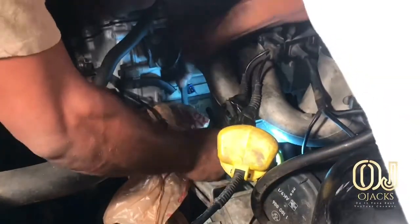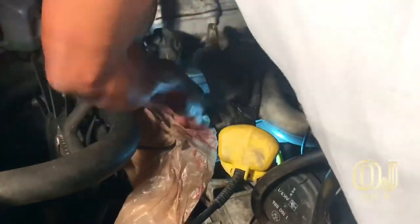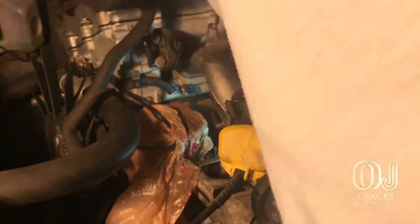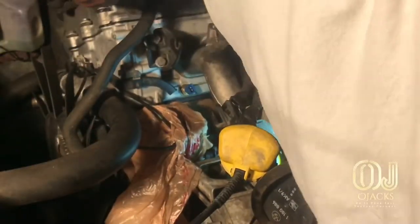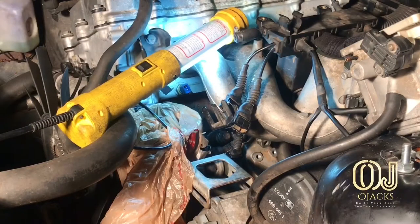So I got a wire brush and started scrubbing around it with the wire brush on the outside of it. And then I vacuumed as much as I could out of there, did some more scraping and going around with the wire brush, and went back and vacuumed some more out of there. And then I got my Dremel eventually and put the Dremel in there and just kind of went around the inner part of that opening and on the outside of that, smoothing it out.